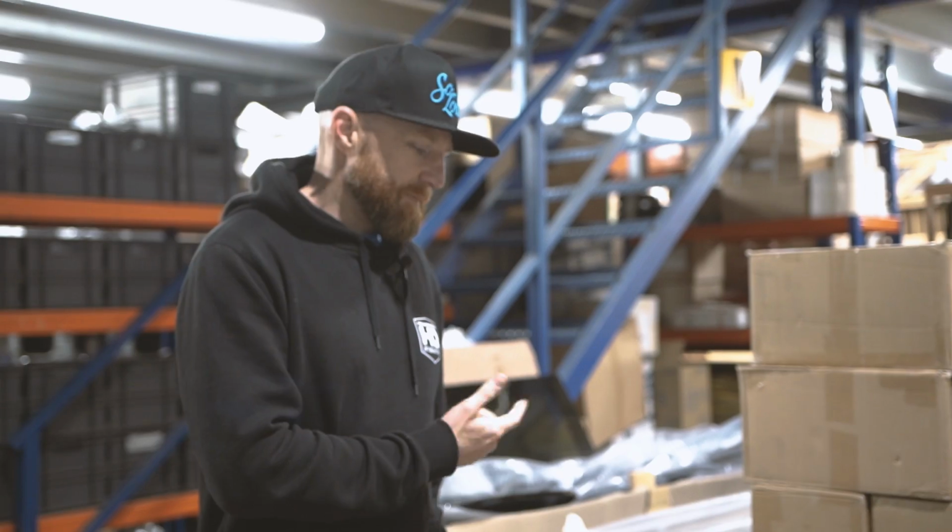Right, so now Mitch has explained the technical side of things, I just thought I'd run through when you would experience this. First of all, don't panic. Don't think that if you lower your vehicle you're instantly going to get drive shaft judder. It's only certain vehicles that do it, and there's no rhyme or reason to it. Some 102s don't do it, some do. It depends how low you go. Certainly, the lower you are, the more likely you are to experience drive shaft judder.